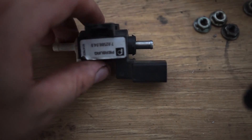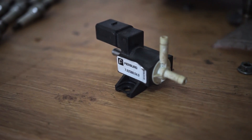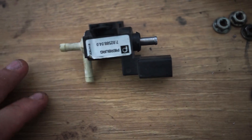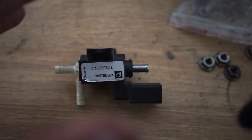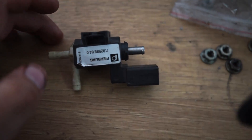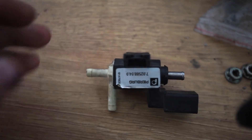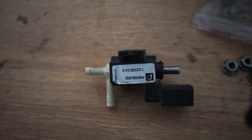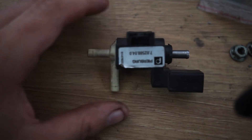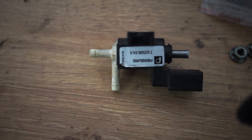Going over how an electronic three-port solenoid works: there are also a lot of boost controllers that use this kind of setup, or a MAC valve — this is basically the same thing but this is a Volkswagen N75. It works in a way where if it is pulsed at a PWM frequency of about 30 Hz, it basically creates a kind of a leak in the hose between the boost source and your wastegate actuator. The line loses air, and therefore the wastegate actuator does not see the full pressure and will open at a later point. The more air you let escape through that artificial leak, the higher the boost level will be.